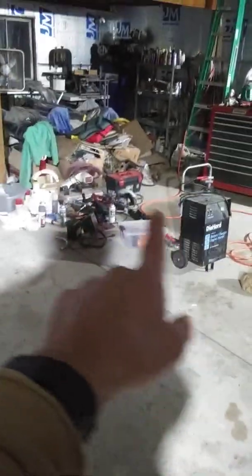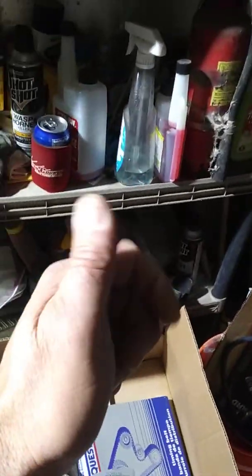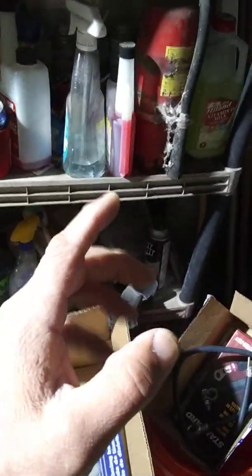I have to have room. I got my boat stuff. This is all from still doing all my work on my boat. And this I'll have to put away, that's for the Florida boat, but that'll wait till next spring. I got to get the Kia, hopefully I can get the tranny and stuff dropped. Take apart half to three quarters of the front end of the car to get a transmission out, just to put in a $3 seal on the main, and then I'm going to put all new seals in the transmission because it was seeping a little. I had to add a little tranny fluid every 3 months. I might have to add a pint. For you snowflakes, that's like 5 gallons.